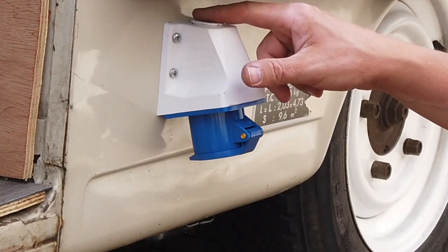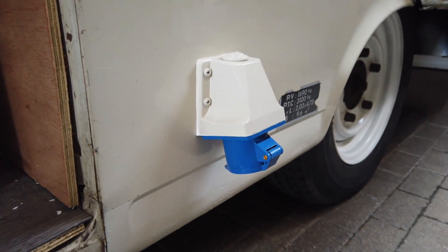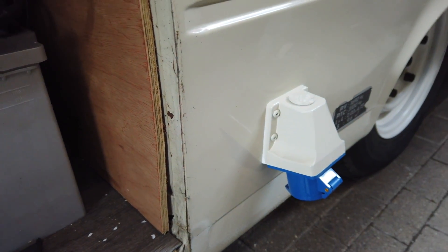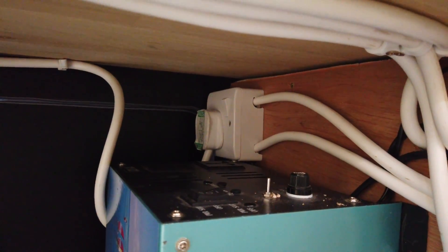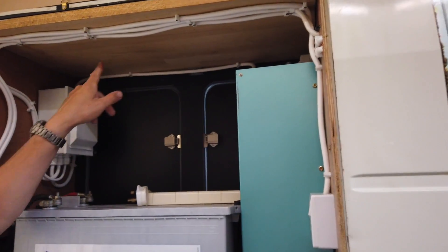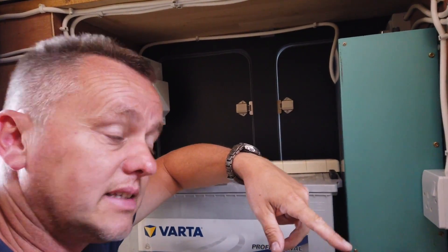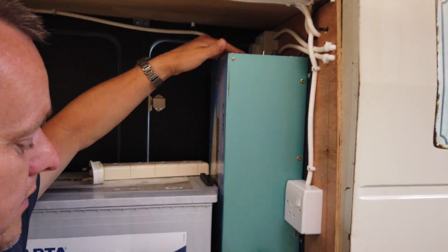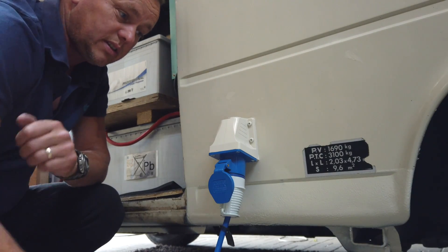I've just got to cap the top off on the end there to stop the water getting in, but that's lovely. So there we have it — 240 volt socket, capped off the top, actually painted the same colour as the van. The wire goes through the side into the inner channel and comes back through to power up the socket. There's one this side and one the other side of the van. If you were bringing this through directly into the fuse board, you'd just bring that wire up and into the fuse board and plumb it in. But because this is running inverters — switching between inverters and mains — when we're not using the hook-up, we just unplug it from there and plug it into the inverter. Job's a good one.